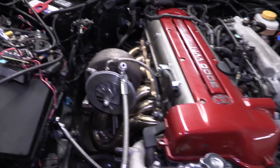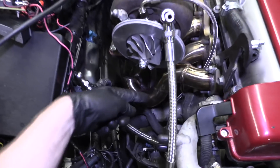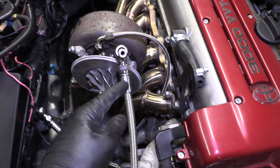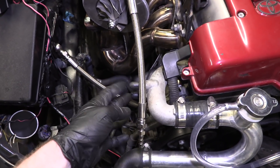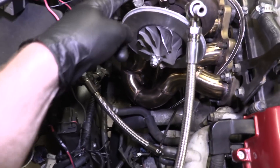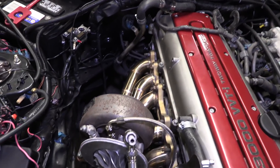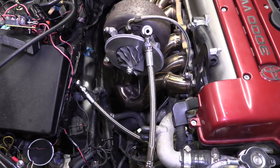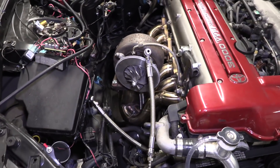Test fitting went great, I've got a plan. Everything looks great as far as the cooling lines and everything else. Quick rundown: oil line is coming from the front oil pickup — the high pressure oil line runs from down there up around into the turbo. Cooling drain line comes down into the neck right here, where the turbos used to go. There are two ports because there used to be two turbo cooling lines — we're going to block off one and go into the other. Feeding the cooling comes from right here, runs up to the single turbo. The lines in the back are getting plugged; the lines in the front are getting used. The oil drain is that massive stainless steel hose that goes down through there.